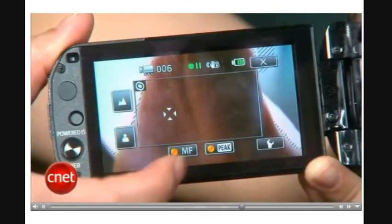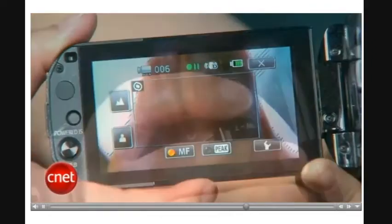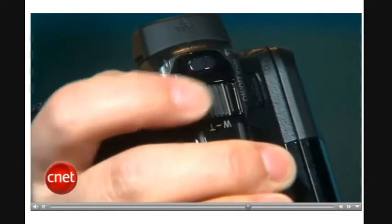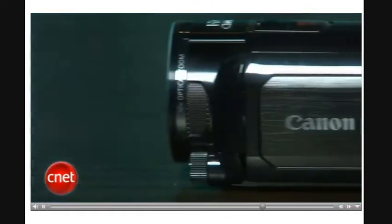time. The low-resolution EVF is better than nothing, which is what the other two models offer, but it's pretty coarse for manual focus. But between the focus assist magnification and peaking for edge detection, it's relatively usable. Zoom feels very nice, and it's pretty easy to maintain a steady zoom rate with it. I did run into a few frustrating situations where the autofocus guessed wrong about the subject, but once it locked onto the correct subject, it didn't lose it. In part, this is probably because of the speed of the autofocus.